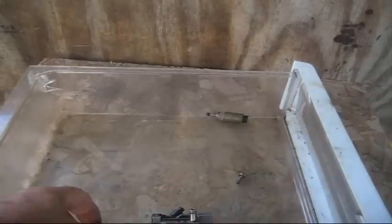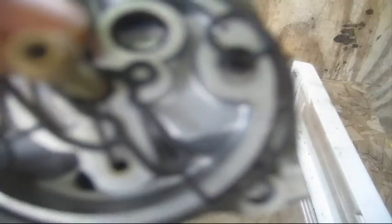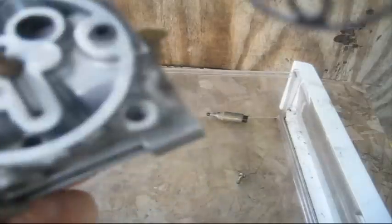The jet goes right in on the back side with the rubber o-ring facing down. Once you have it in there you can push it down with the back of a drill bit or a punch if you have one on hand. These plastic parts do warp, so you have to look out for that — it could cause a leak and flooding condition. This Nikki carburetor has one main piece, and this o-ring here was distorted and was causing some flooding.